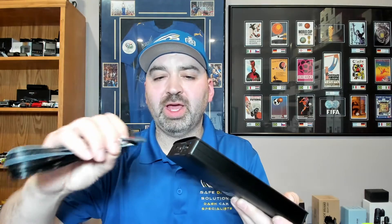I'm a real fan of how some of these newer battery packs work. I know people will say I'm siding with it because we sell it, but as an installation technician working on newer vehicles constantly, I prefer certain installation methods. The iVolt Extra still has a power and ground connection, but the key difference is this power and ground connection hooks up to constant power and ground — not ignition.